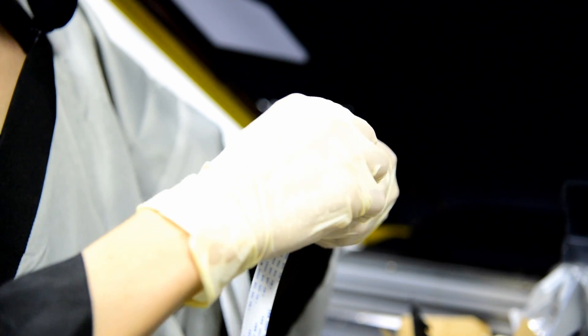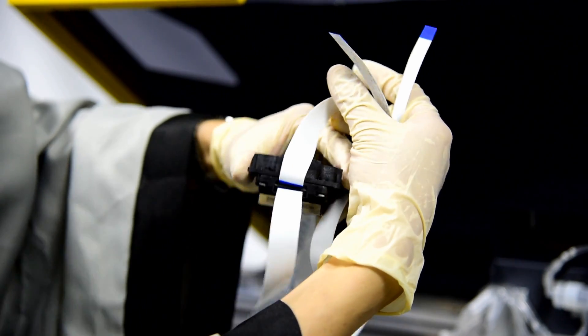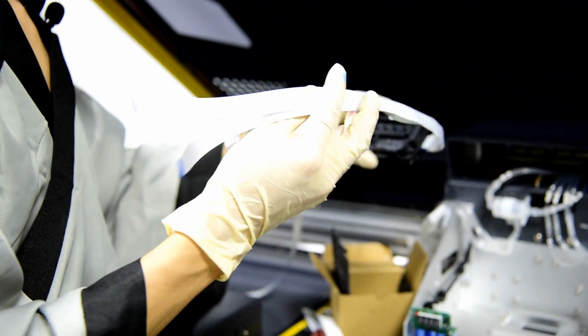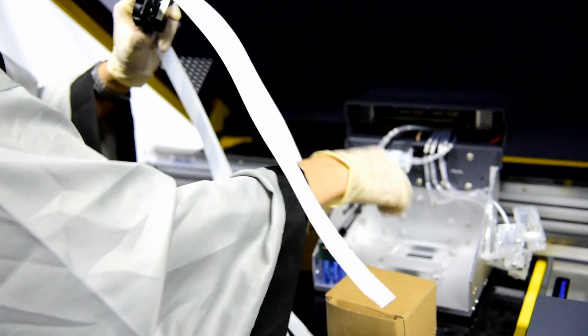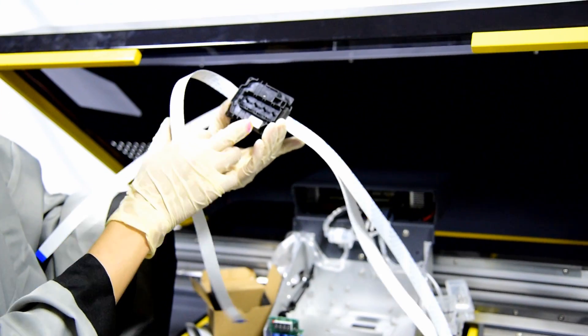Double-check that it is not bent, the connector is secure, and there is no scratch. The blue protective film should be in the middle on both sides. For one print head, we need to install four cables. First we install the white print head — this is the white port and this is the color port. We put the print head in with the decoder at the front.